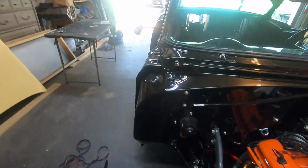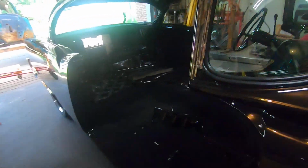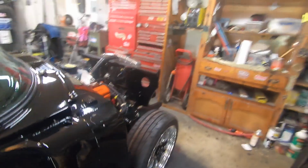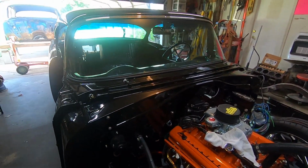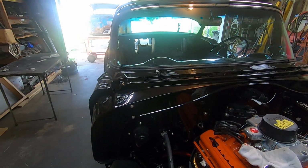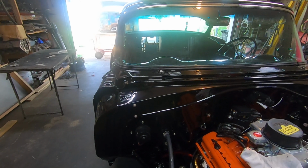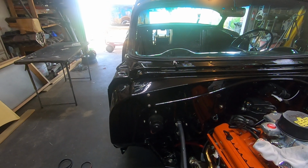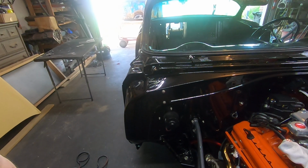The firewall pad, to attach it to the firewall, normally you put your firewall pad in these cars right here. They're attached by these clips that go through the firewall. Now, if you're using your original steel ones, or you can get them reproduction, they remind me of shark teeth. When you've got a brand new painted firewall and you go to attach those, they normally flake the crap out of your paint around that hole, and you're going to see it.